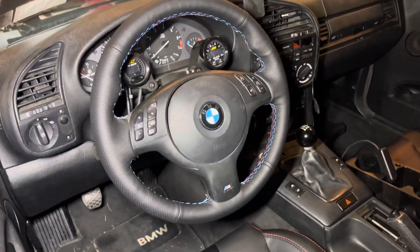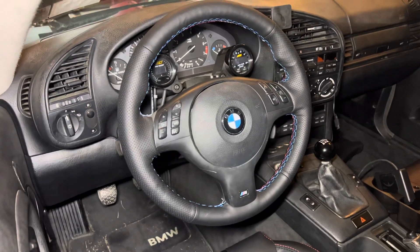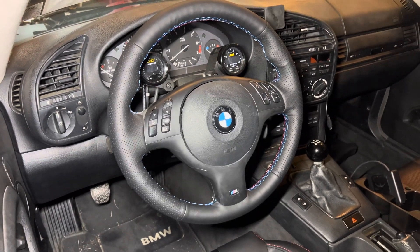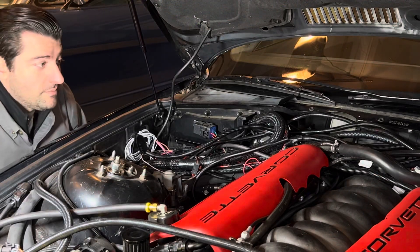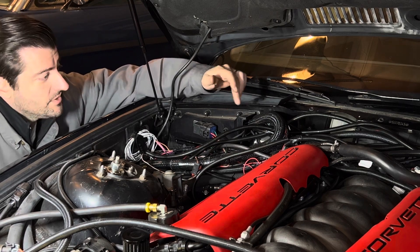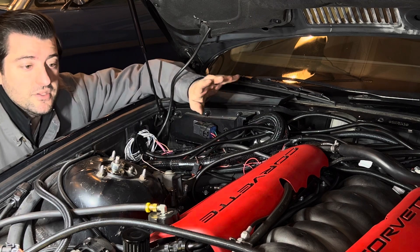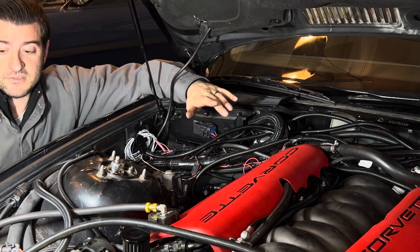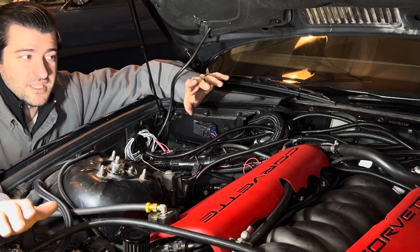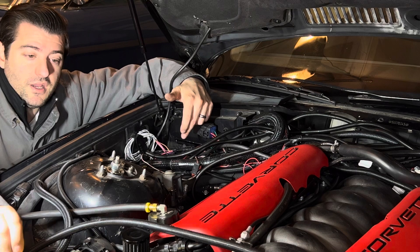Some of you BMW purists might be wondering — that is an E46 M3 steering wheel in my E36. Yes, it fits, and I made a video on how to wrap it as well as install it. Make sure you subscribe to the channel for videos like that. On my car, I have my Terminator X going back into the factory PCM location for a BMW E36. The Terminator X is a big loom that comes out, and there are four inputs and four outputs you can use to control different things. I currently have one controlling my fan, and I'm going to use a third output specifically for my boost controller.